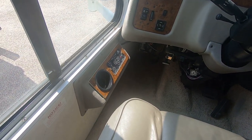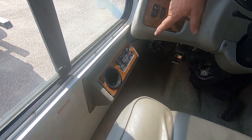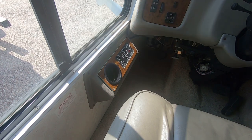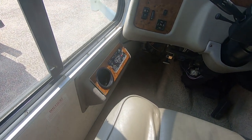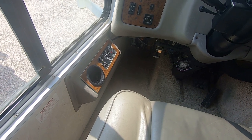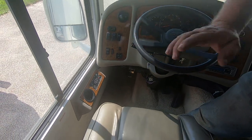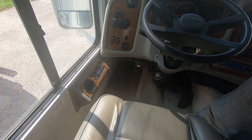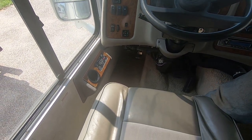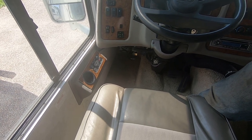When you're ready to go: brake still set, turn the key on, push the on button, then push retract. You'll feel the jacks come up; when the red light goes out, jacks are up. If you push front, the front two go down. Push back, the back two go down. You can also do the left side or right side independently — two at a time depending on which button you push.